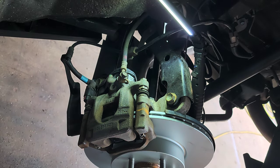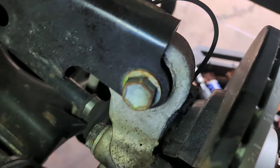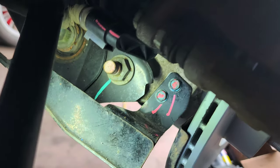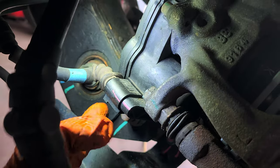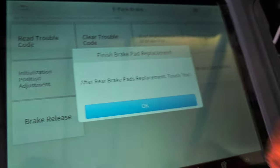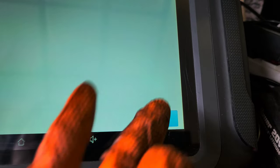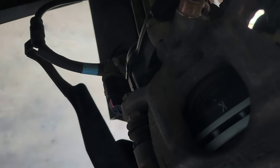Now the scanner part. Go over here, press 'Finish brake pad replacement.' After your brake pads replacement, touch yes — you're going to hear the sound again. Waiting for your operation, current state — press start. You heard that? We're Gucci now.